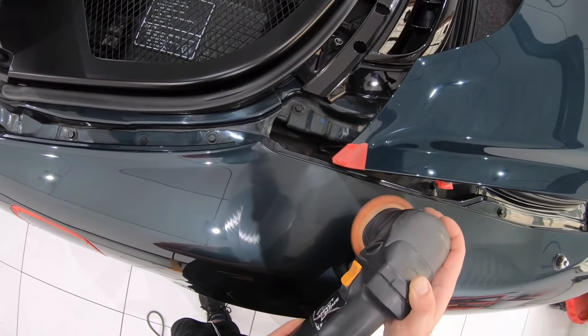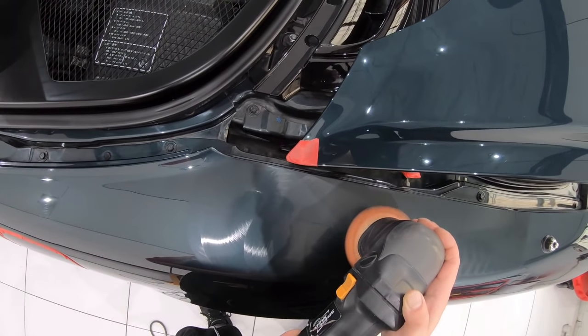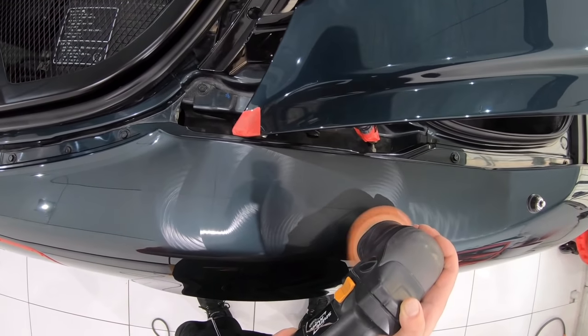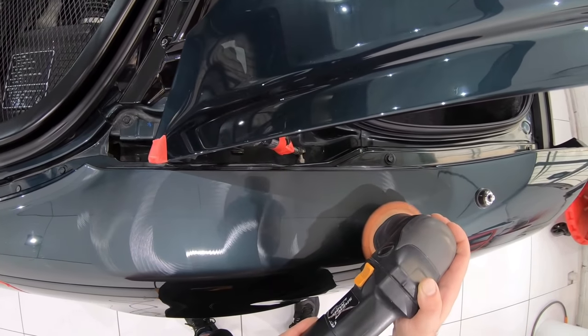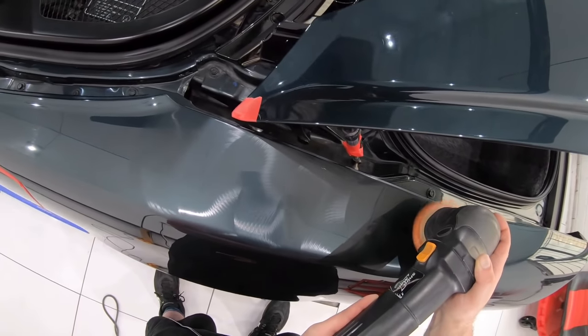And although I still can certainly get them looking their absolute best, a lot of the time you just need to accept that your paint correction work can only be as good as the paint you're given to work with. And seeing that there's already a burn mark in the finish, potentially indicating that the paint is also quite thin, you need to tread lightly and not go too far with your correction.